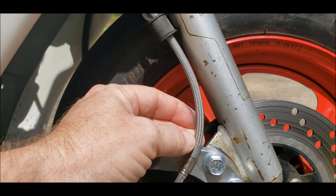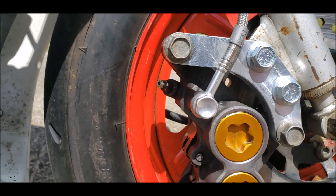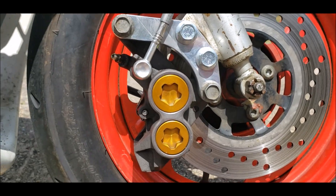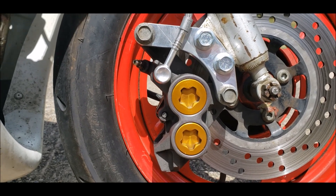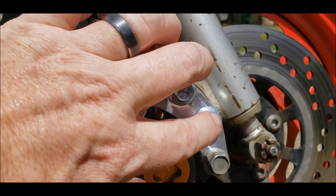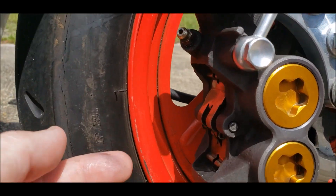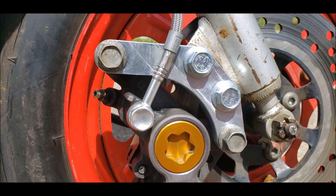This is a little bit different — normally I would use the factory setup for the brake line to the left of the built-in stop, but then the brake line looped way out to the side. I really wanted to use the stock bushing to keep things in place. This is a really nice line — super fine mesh covered in plastic. Bought new banjo bolts, so everything looks good. Now the R1 caliper on the YSR is rotated counterclockwise from where the stock position is on the R1, so that changed things. I didn't have a lot of room to get all of this to work out.